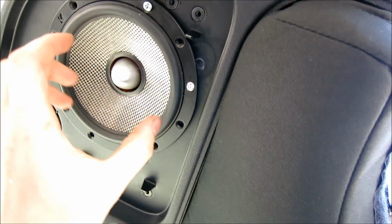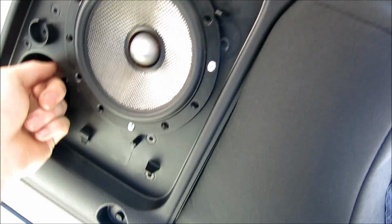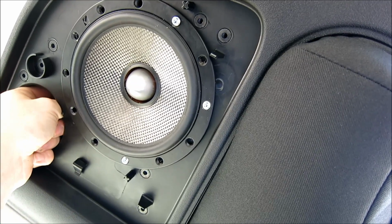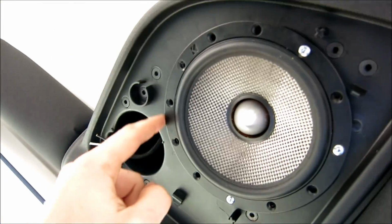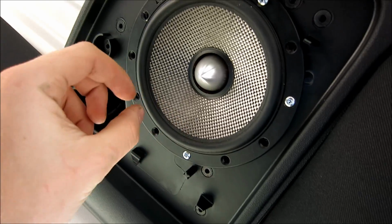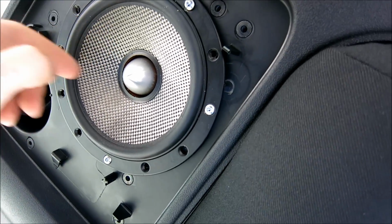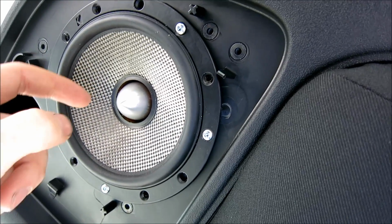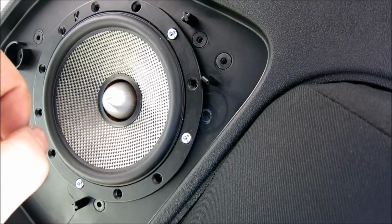The fun one will be right here if you've got this. So say you've got your tweeter right here. I'm going to pull the woofer out again, and you'll see that the woofer and the tweeter meet together. You can either run a new wire into this box, or all you have to do is wire this part that's coming in through here, cut it, wire that to the tweeter port of your crossover, then the mid driver one, just hook that one up, and then solder either the other side of the tweeter wire that you cut off or the other side of the woofer wire, like cut off the plug of the woofer wire, and you're going to hook that up to the input so it gets that from the amp, and then you're just going to replicate that with both sides.